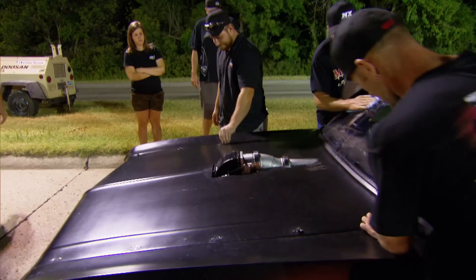It ain't gonna work like that. So right before the race, we noticed that the front end of the car is sitting about three inches lower. I'm pretty sure that the new springs we put in have settled, but there's no way that we can race it like it is. You can damn near see the whole tire. If I try to race it the way that it is, we're not gonna get the weight transfer that we want. And instead of the car launching with the wheels in the air, it's probably gonna blow the tires off.